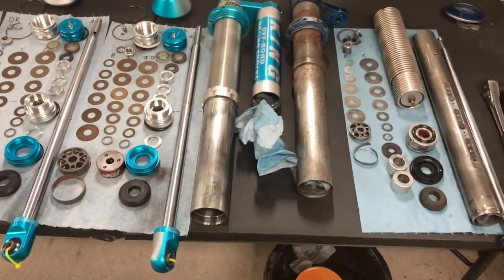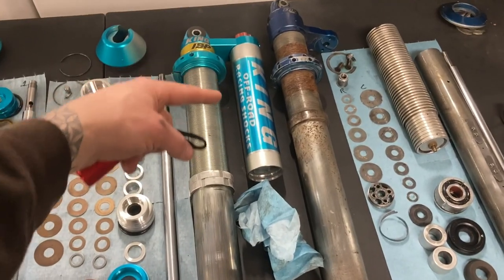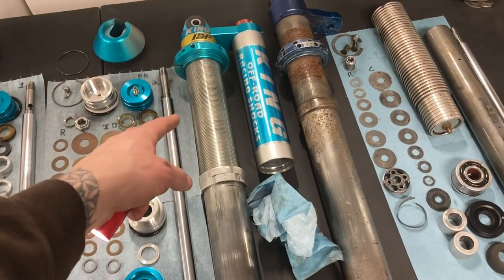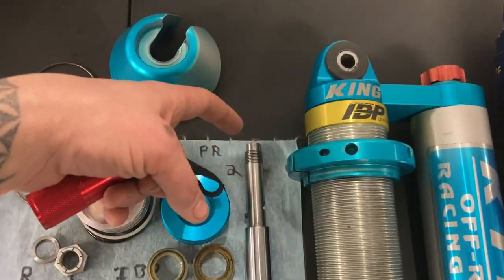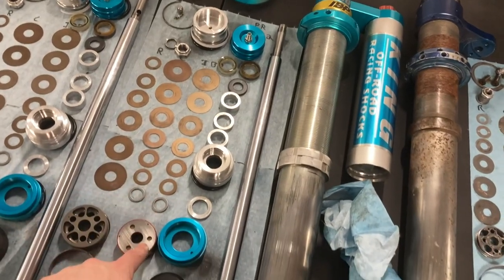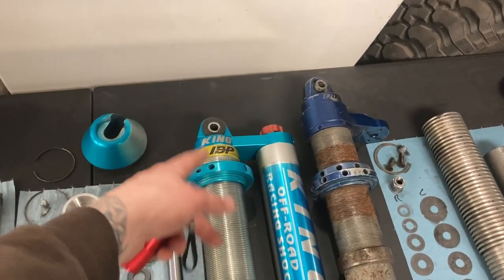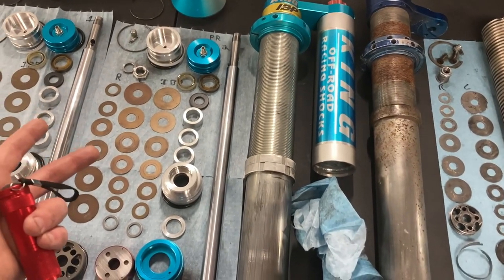See that - it's a long skinny piece up in there. So imagine all this stuff assembled on the end of that shaft. When you're jumping or doing whoops and the shaft is coming up, once the top of the shaft gets up to that piece, it starts going inside and closing off - it bypasses oil, hence internal bypass shock. It engages or disengages the bypassing depending on how you look at it.